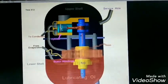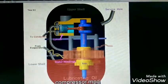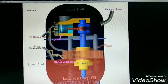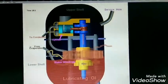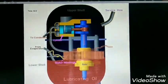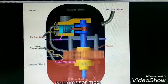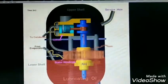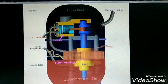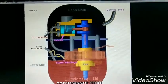At the top of the cylinder head, inlet and outlet valves are placed here. This is the suction line which comes from the evaporator. It is routed around the electrical winding and then connected to the suction port. As the suction line has low pressure and low temperature, it helps in cooling the winding.